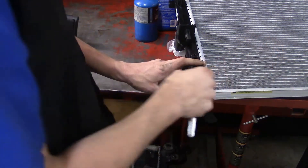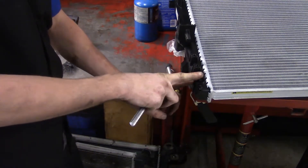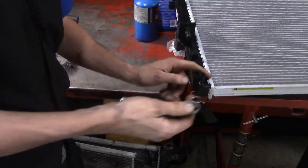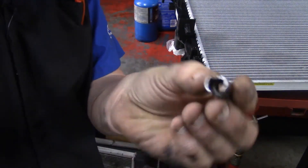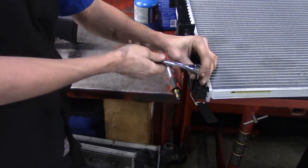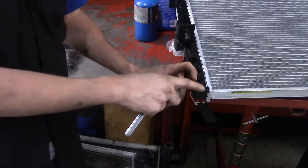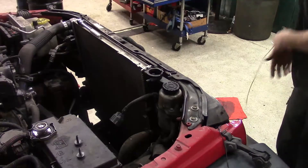The drain is on the passenger side of the radiator facing the bumper, so it's kind of hard to see visually without getting under the vehicle and maneuvering and taking a few things off. If you can get a pair of pliers in there, great; if not, I've got a quarter-inch socket that I've cut and made a groove in so it fits over the end of the drain, and I can get in there with a quarter-inch ratchet and back it out. If you don't want to fight with the drain, taking the hoses off will be fine too.